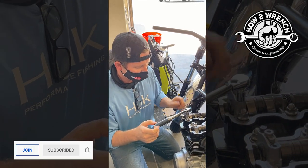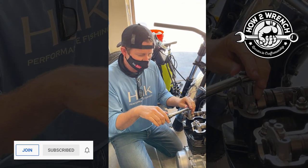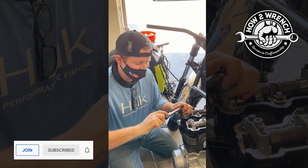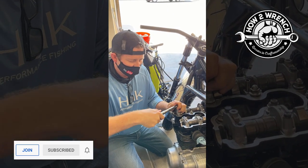This bolt was supposed to be torqued to 96 inch-pounds. If I go to 96, the bolt isn't even wanting to move or doing a thing. So all you've got to do is just start turning it up — I don't even need to read the dial, I just sit here and keep going.